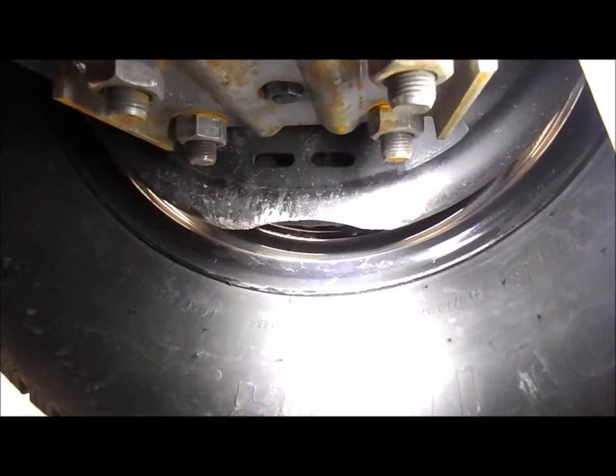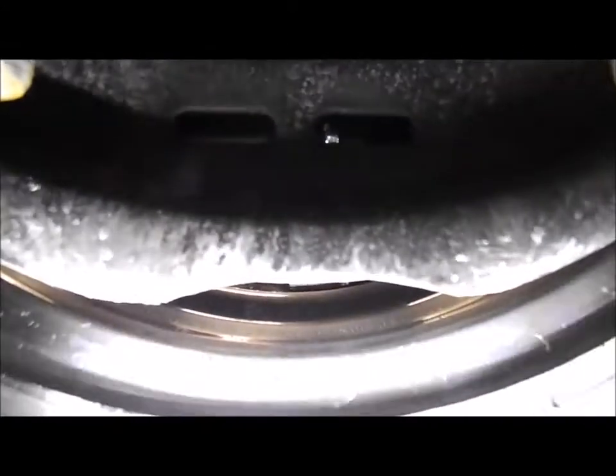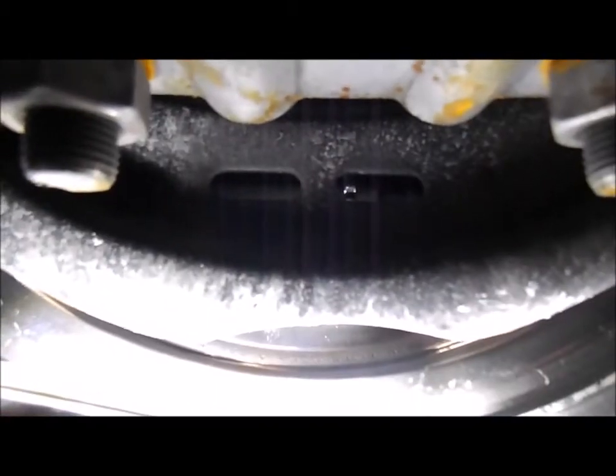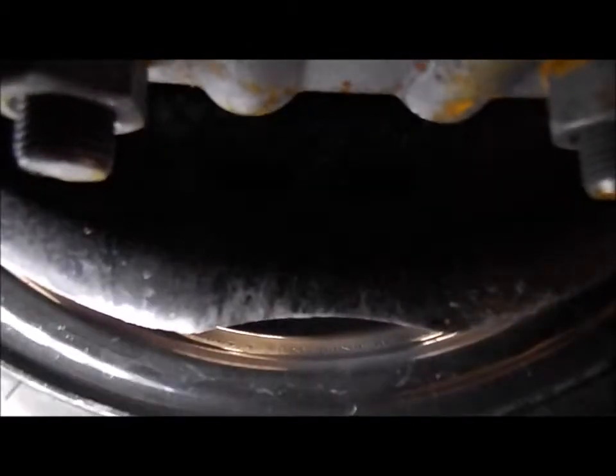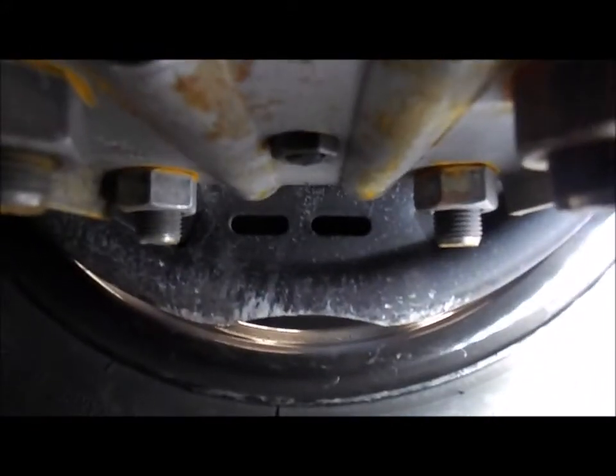What you're doing is moving the brake shoe against the drum or away from the drum — so you're pulling it back in. I pushed it out until it was dragging pretty good, and then you just pull it back. It's threaded — it's on a threaded rod. Good thing I have a jack stand underneath, because the jack keeps dropping. You can kind of see the threads there.